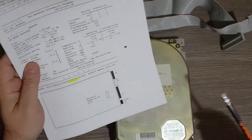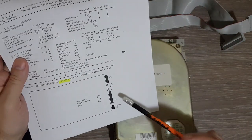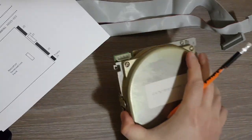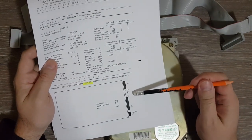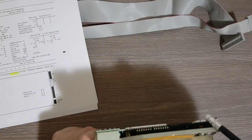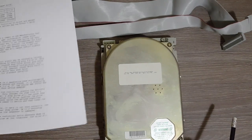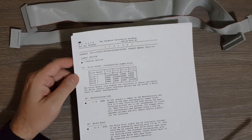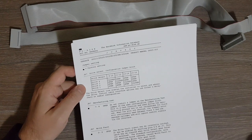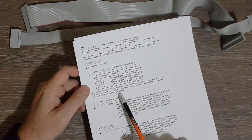The manual shows the power connector is called J3. The larger connector is called J1, next to the power connector. Then we have the jumpers called J7, and finally the J2 connector which is this smaller connector. In the manual we have some jumper settings — we can specify which drive this is, enabling the drive select line which allows the controller to select and address the drive.